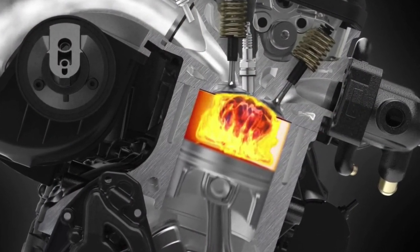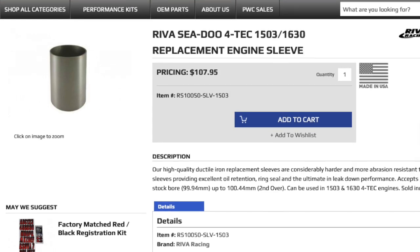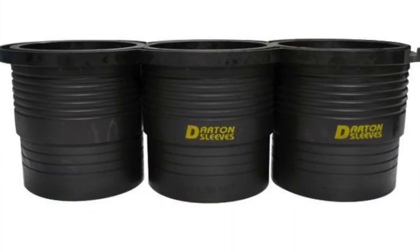Is it possible to bore the cylinders and sleeve back to stock bore to avoid plasma coating failure later down the road? I do not know the integrity of the cylinder. My gut instinct is to say yes, you can sleeve it. But my hot rodder side says: A, I don't know the measurements off the top of my head, I'd have to look that up. B, I know that Riva already sells those sleeves, so that leads me to believe that people are already doing it. C, I know that guys who compete in hydro drags are running sleeved engines. So yes, it's doable. How affordable is it? Not very. But it is doable.